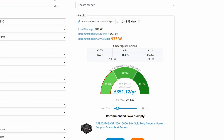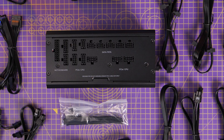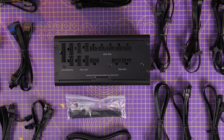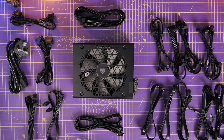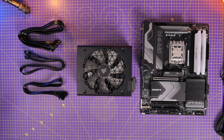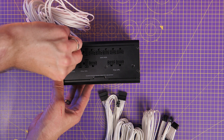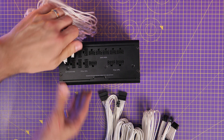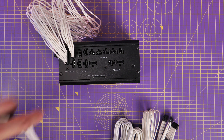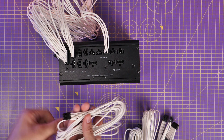You don't want to buy one that's too big and you also don't want to buy one that's too small. Don't skimp on your power supply unit — it's one of the most important parts of your build. If you buy a cheap one that shorts out it can cause problems, perhaps destroying your entire system. Buy something reliable from a reputable brand with the right wattage, and also 80 Plus Gold rated to make sure it's efficient. I'd recommend a modular power supply unit — most modern, quality ones are. These allow you to just plug in the cables that you need and nothing else.